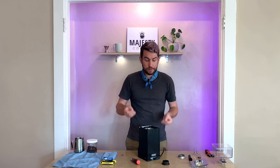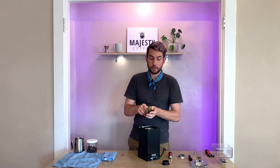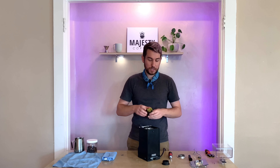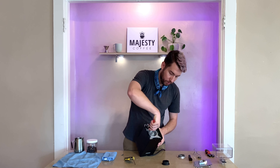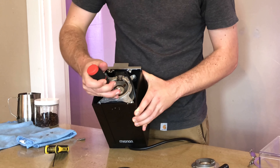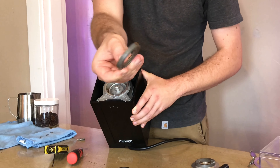At this point you're going to need something to help lift out that bottom burr — whether it be a long flathead or a skinnier Allen key might do the trick. Just want to be careful we don't nick them or cause any damage, as they are very important in giving you consistent grounds. You want a slight bit of pressure and also a little bit of daintiness in your work to make sure you don't cause any significant damage. Going all the way around and gently lifting up — you'll feel it start to give. Got that bottom burr out.